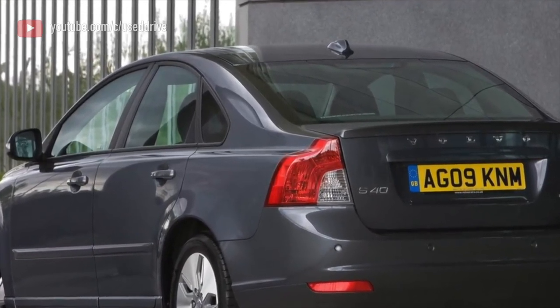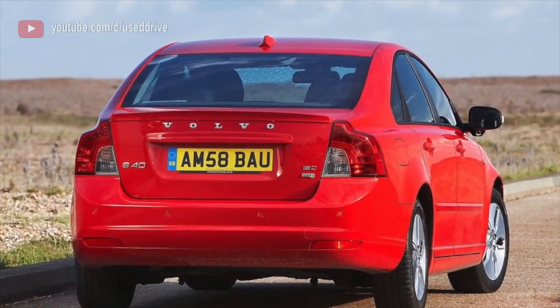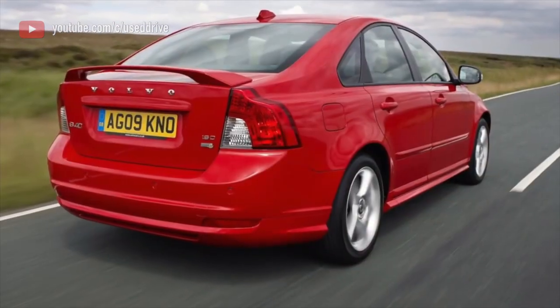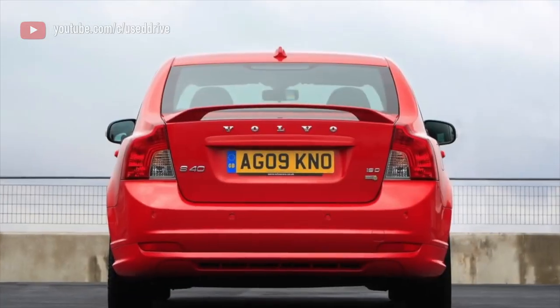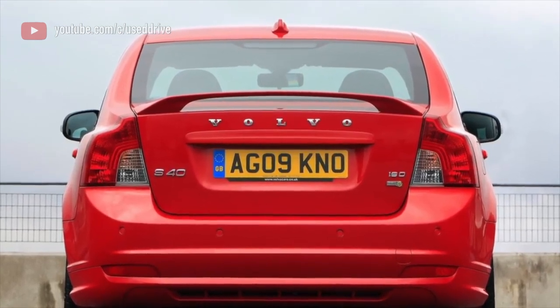The manual transmission drive is made by a rod, similar to that on the VAZ 2108, and the quality of the drive is even worse than that of the 2108. Literally, within a year or two, backlash in the drive becomes at least uncomfortable. Often, you cannot engage reverse, first, or second gear, and sometimes you have to go with whichever gear you were lucky enough to get.